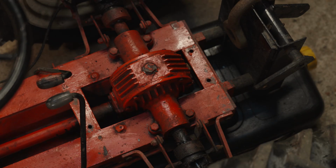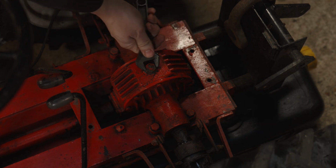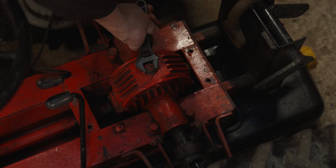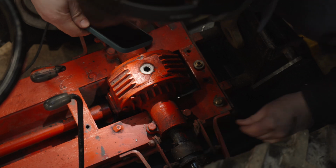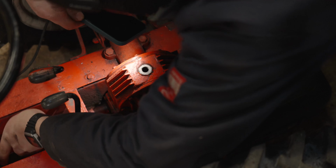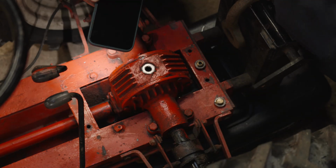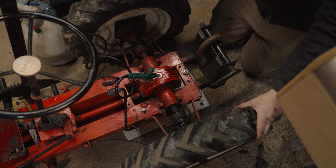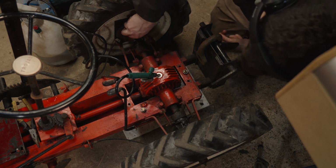Smells bad. Right. I'm now replacing the gear oil in the bevel box. It's not a normal diff, it is a bevel box because it has a constant drive to two dogs that then have corresponding dogs that go to the wheels. So you can engage one wheel at a time, if you like, to help you steer. After I drained the bevel box, I just filled it up to a level fill plug with some EP90 using my little garden fence sprayer thing.